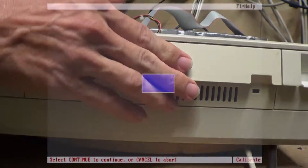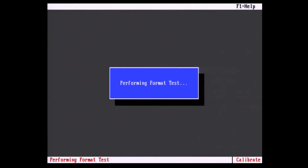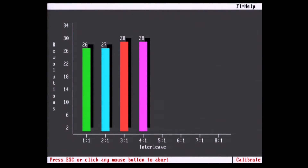During the low-level format, I was worried I got the interleave setting completely wrong. Interleave is quite important — basically, when the computer is ready for the next sector on a track, you want it to be just about to hit the drive head. If it's already gone past, the drive has to go around a whole other revolution just to read that sector, and on a drive with 26 sectors per track this could make file transfers very time-consuming. Using Norton's Calibrate utility from Norton Utilities Version 6, it tests this for us and gives bar graph results. At interleave 1, the drive needs 26 revolutions to read one track. At 2-to-1 it gets slightly worse at 27, at 3 it's 28, at 4 also 28, and at 5 — only 5 rotations. So we need an interleave of 5 to get the absolute most performance from this hard drive.